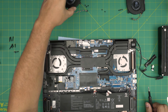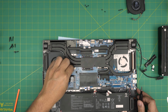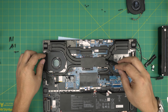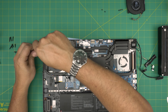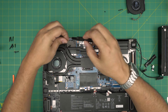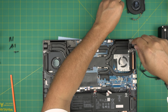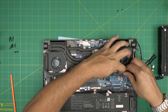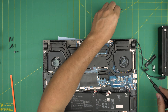Put the fan back in — if you cleaned yours, slide the jack right inside the connector. It can go underneath or on top, it doesn't matter. Put the three screws for the left fan and three screws for the right fan. Put the tiny screws on the heat sink corners so it doesn't sag when flipped. Before placing the fan, I'd rather connect the connector first — it gives more room to work. Then put the bottom corner in first, set it down, and put the three screws.